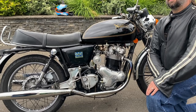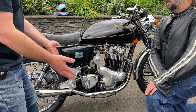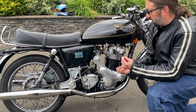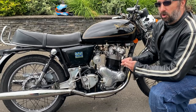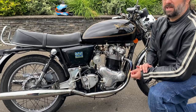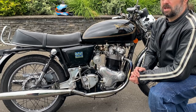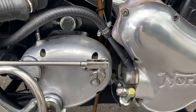Just in your opinion Dave - I'm not particularly keen on the anti-sump valves at all, unless they've got a micro switch or something like that. I don't mind even dropping the oil out to be honest. But this is extremely safe. The disadvantage of having a spring-loaded valve in-line is it relies on the suction of oil coming down into the oil pump to move it off its seat, provided you have enough suction. Where they put the valve here, it's against the oil pump on the high pressure feed, so it's the high pressure from the oil pump that's actually pushing the ball back. That's a lot more safe and less likely to fail. Nothing really can happen because the ball will just move out of the way and oil will continue to flow - there's nowhere for the ball to get stuck against.